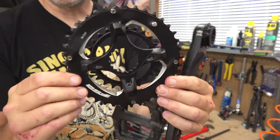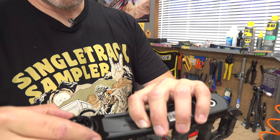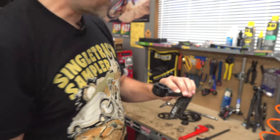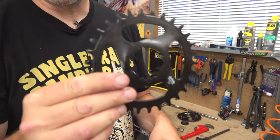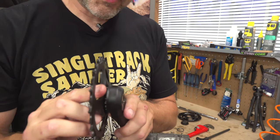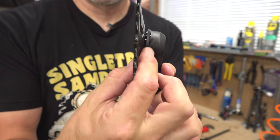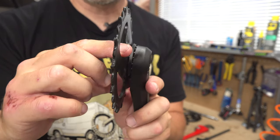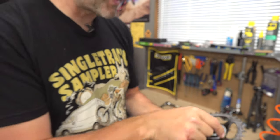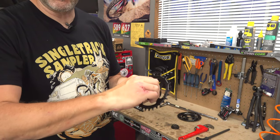You'll see it's grooved — it's got a pattern that matches up to the crank arm. Just be careful, there is another spacer that was on here that can fall off, so make sure you're paying attention. The new chainring is notched just like the other one and will only go on one way. If it's not on properly you'll see a gap between the chainring and the crank — you don't want that. Move it around until it's sitting flush. Then put the lock ring back on, being really careful with the threads to make sure they're lined up right before you crank it down, as they seem to want to cross-thread pretty easily.